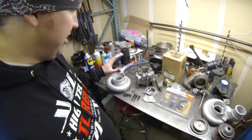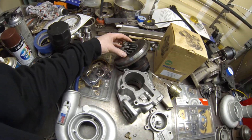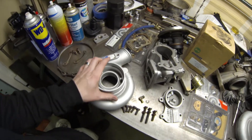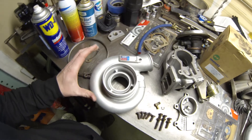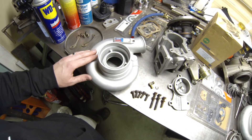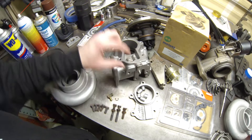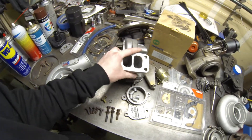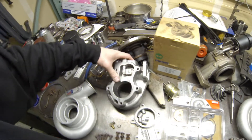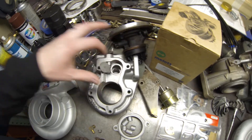That's what we're going to do with that turbo, and then the same kind of thing with this one — except we just bought a rebuild kit for this one, so we're going to take it apart, hopefully it's not too bad of shape, and rebuild it. We did the same kind of cleaning on the compressor housing — blasted it. This one had actually already been polished; whoever had it before took off some of the casting marks. We might machine a bevel on the inside for a nice transition. We also did a bunch of work on this turbine housing — cleaned it up, blasted it, and drilled out the wastegate port about as big as you can go, about one inch. We also drilled out between these two.